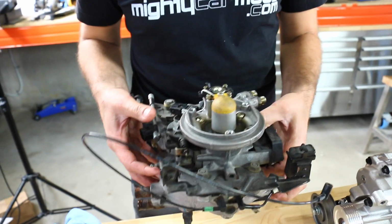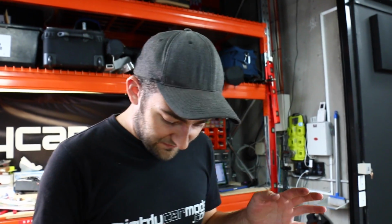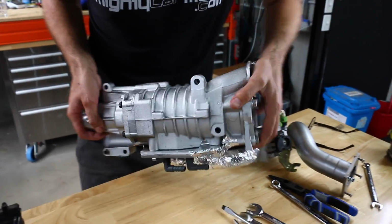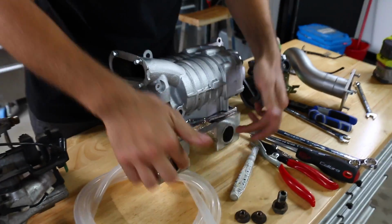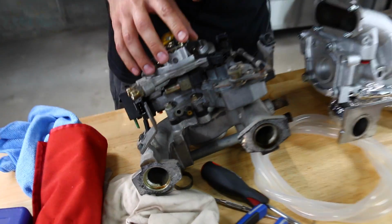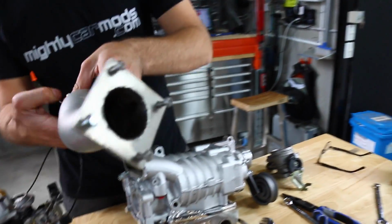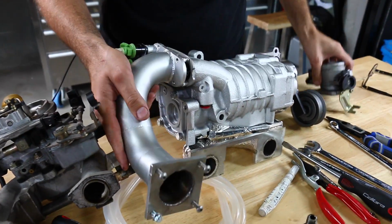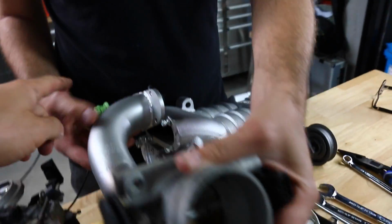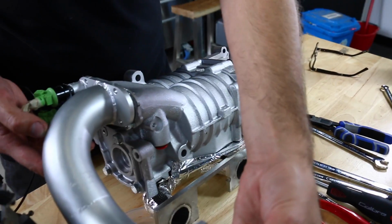Now most cars these days have what they call multi-point injection. In the 80s and 90s they liked to write that along the back of the car, especially on Mitsubishis. But that is again slightly different to what we're doing here with our awesome big supercharger. So you can see there how it matches up. We've still just got the 2 ports, it's all still going in through those 2 places. But instead of having one big dirty injector on the top of it and no forced induction, this is pressurizing the air, and on the inlet we have a multi-point. Exactly, 2 injectors. There's our throttle body, 2 injectors, into the supercharger. Boost.